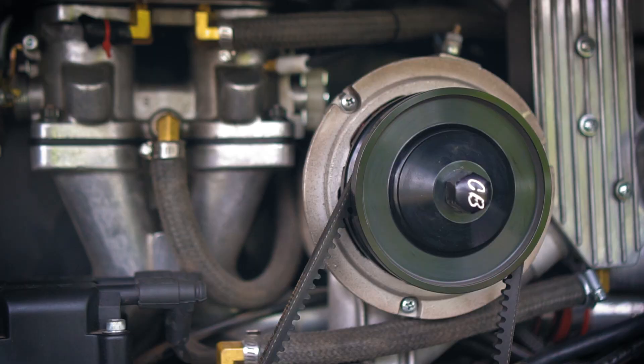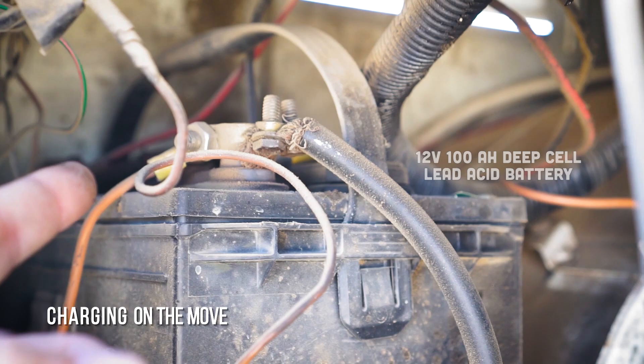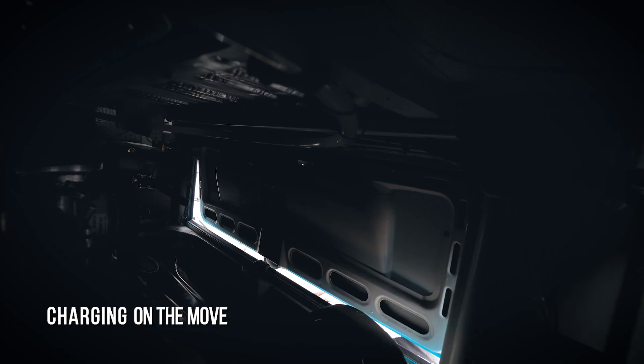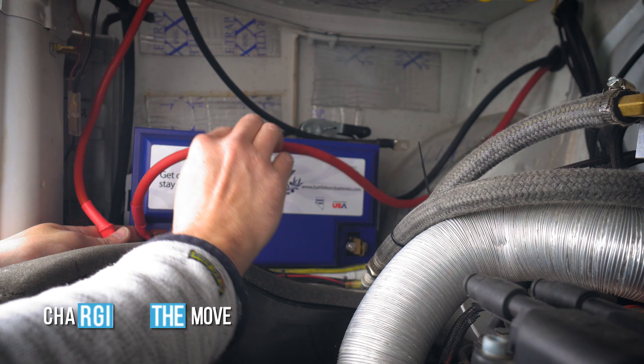When you're on the road, you have an alternator. A 12-volt alternator can be applied directly to your lithium ion battery bank in 12-volt configuration to charge it. There are many devices available to hook up an alternator to charge a second battery bank, some as cheap as $20, but you'll never reach 100% state of charge with these devices. A lithium ion battery can be charged so fast with such low resistance that it will basically max out your alternator, and over time that could damage and shorten its lifespan.